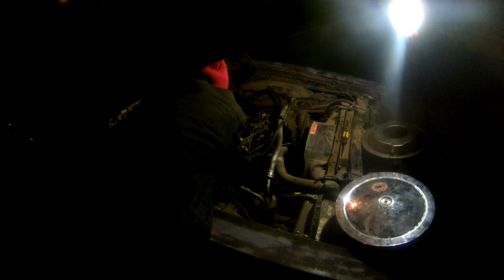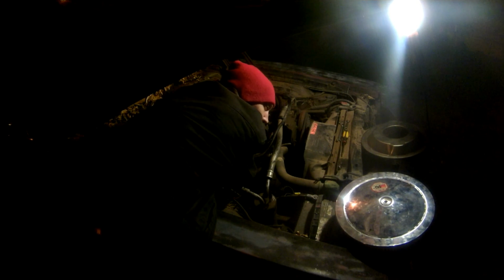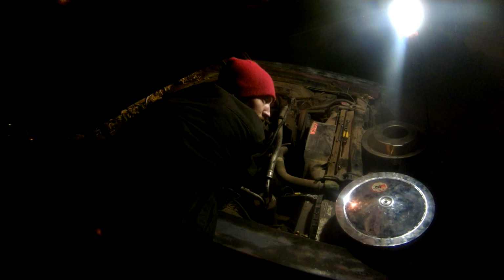It's right underneath your choke. Plug it in. It's actually right underneath the left mixture screw. And where's our EGR? Do we want to hook up EGR? Yeah, we gotta hook up EGR. We don't have emissions laws in Kansas, but we want to hook up EGR. It's designed for it. It'll get a little bit less horsepower with it, but we're safer for the environment.